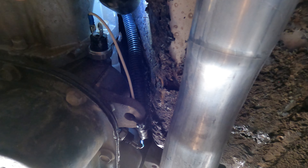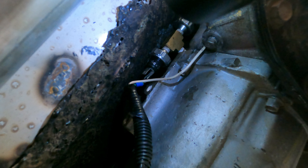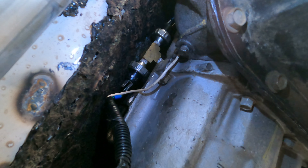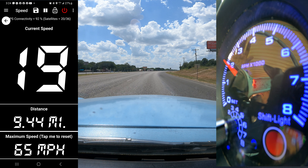So it turns out this port and this port are wrong. There's a port way up back there — you can barely see it. I'm going to have to put both of these sensors on that port with a T-fitting right here. So I'm going to go ahead and relocate it, and hopefully it fits — which it doesn't look like it's going to. I can't get my ratchet in there, so I'm just going to take my pry bar and bend this trans tunnel out of the way. That's what it should look like — I'm right up against my floor, and that was a pain in the butt to get in. Hopefully I got enough thread tape where it doesn't leak.